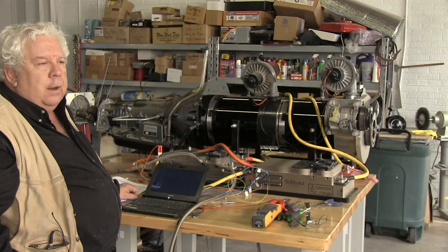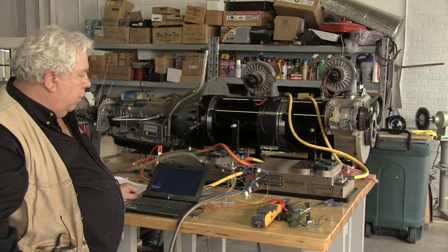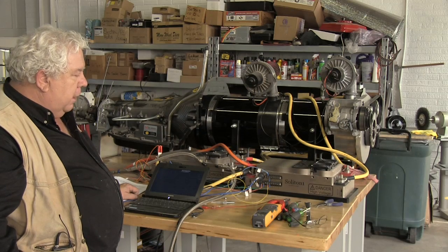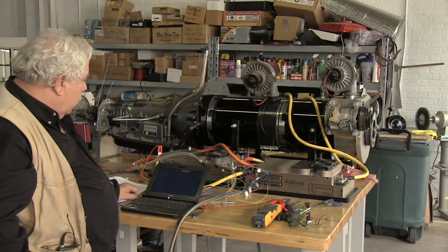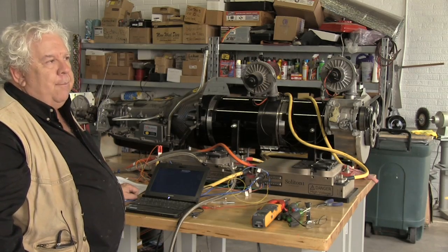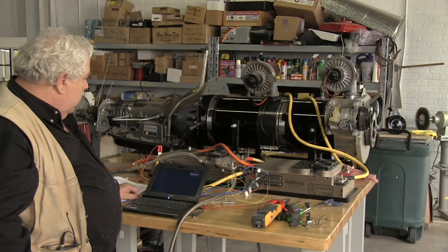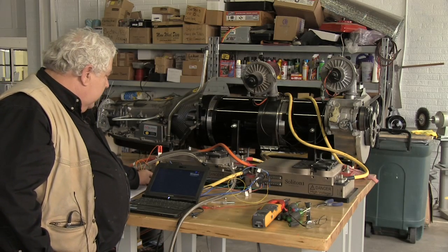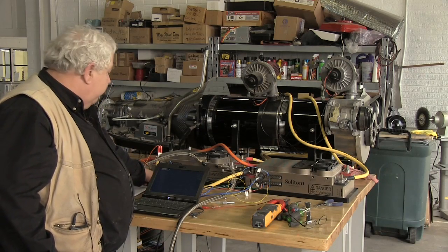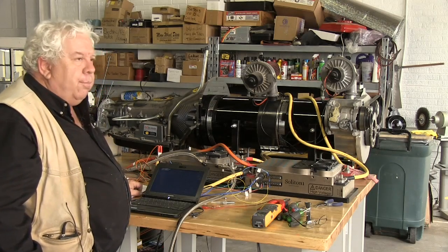And I had quite a difficulty, and always do have, getting the tachometer to work. This is one thing I don't like about the Soliton 1. All of the inputs and all of the outputs generally require additional circuitry. Now that makes it fairly flexible, but it is terribly awkward. For example, for the tachometer, I need really a 2.5K resistor. I used a 1K and it worked fine, between the throttle input and my 12 volts as a pull-up resistor.